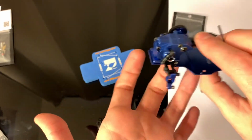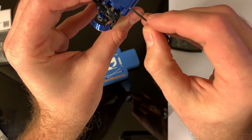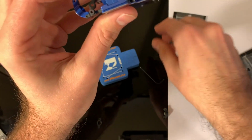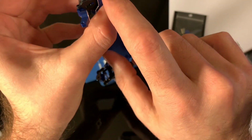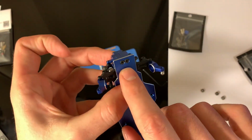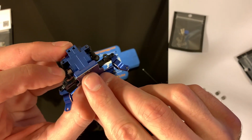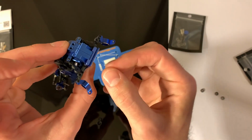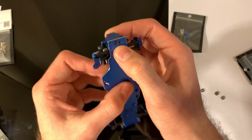I guess my screws aren't tapping out. You saw that, guys. These differential holes back here are stripped, and they came pre-stripped from the factory. That's terrific. I could go grab some Loctite, so if these come loose, I can Loctite these in there, and hopefully that'll help. Put some Teflon tape on there too, and that'll help expand the threads a little bit so I can get them fitted in there. So this is going to be my problem spot to watch on this chassis.